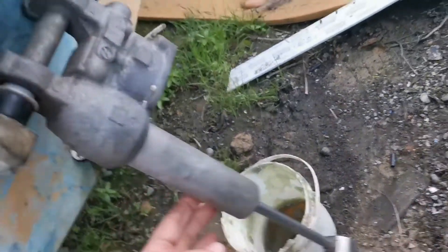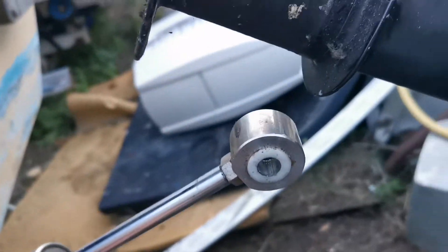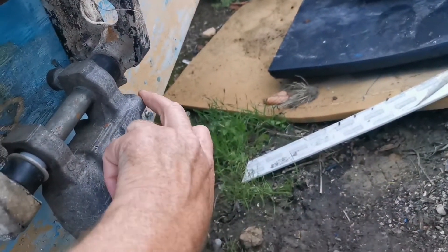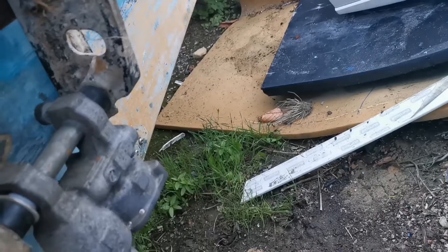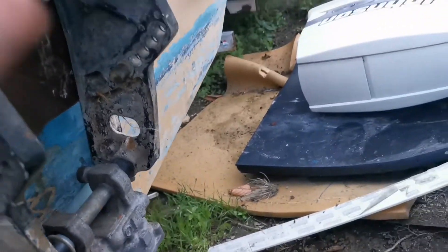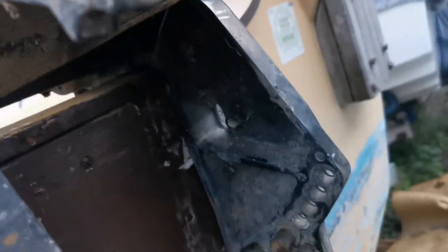To take the motor off, you've got a little flathead screw on that side which you can access through this hole here from around the back. Turn it anti-clockwise and it'll stop — it won't come out — and then you can lift the motor manually. I've propped it up with a block of wood under there.